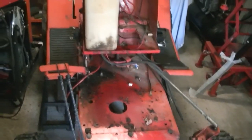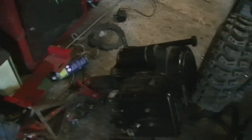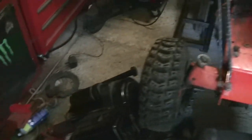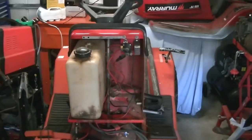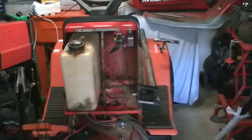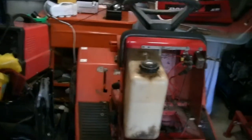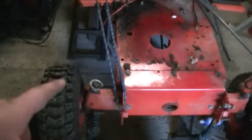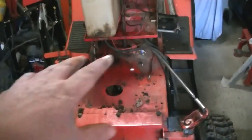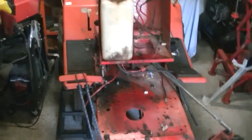I've got the engine off just now. It's only a matter of four bolts, and a couple of bolts for the little cross member underneath just to get to the belts. The next job will be taking the wiring off. I'm going to turn it around, take the mudguards off — wheel arches, whatever you want to call them — off the back because I've never looked inside to check it out. Then I'll drop the axles and get the flat chassis or frame to start stiffening it up. I'm not going to go over the top with the stiffening because I'd like a little bit of twist in it.